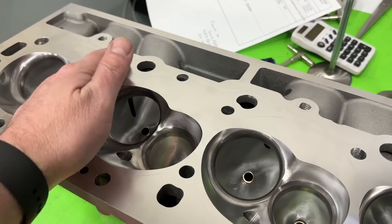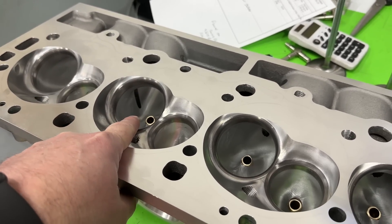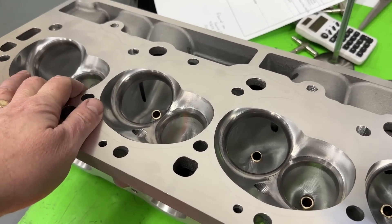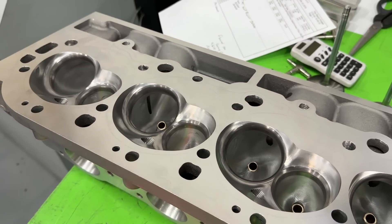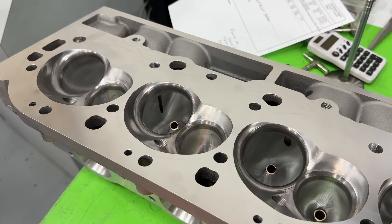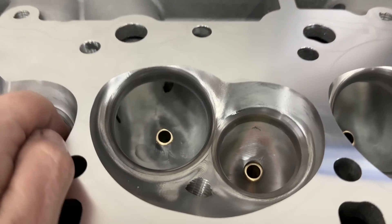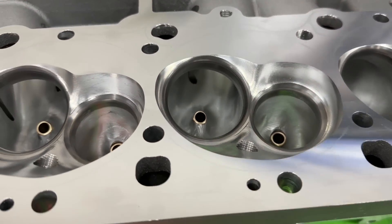It's not something to worry about. If you're running on a stock block, you put thread sealer at the top, which you'd do anyway. This probably isn't going on a stock block anyway, but what you will do regardless is put sealer on the washer and nut if running a stud, or the washer on top of the head bolt - put some silicone there to prevent sucking oil into the port. If done right, it's never an issue.